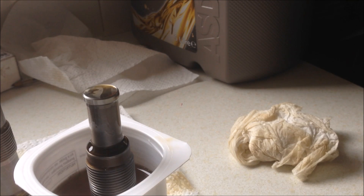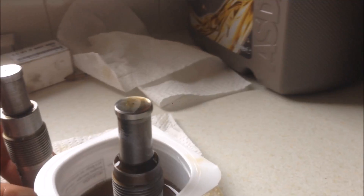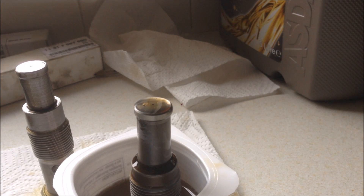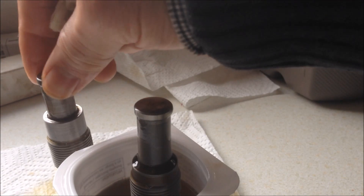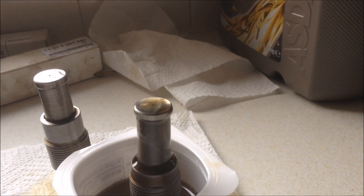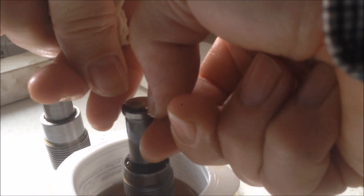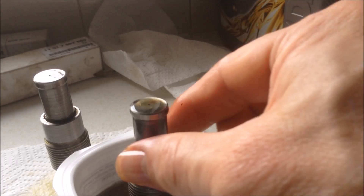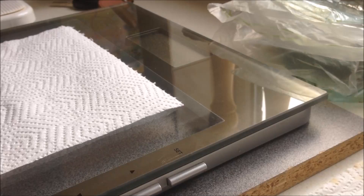Now what I'm going to do is use the weight scale to press down and roughly compare the two tensioners. I suspect the old one may have a problem — not only because of the old design, but there may be an issue with that specific piston. But whatever, we will try. This new design seems good. I nearly fill the oil for this new design — as much as I can, I can't press down anymore. A lot of oil is coming from the small hole when I press.